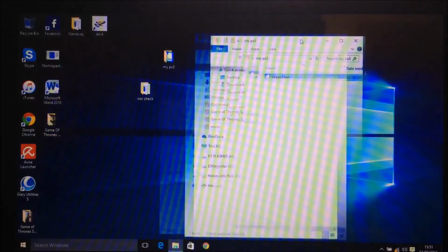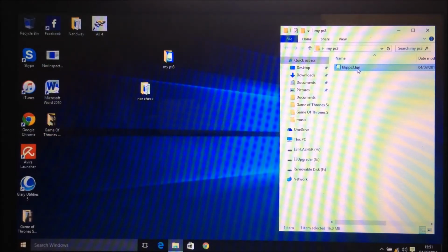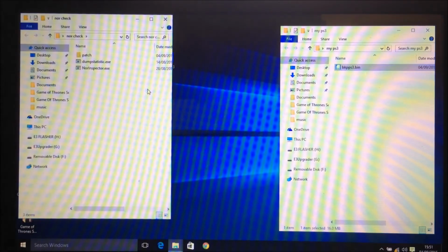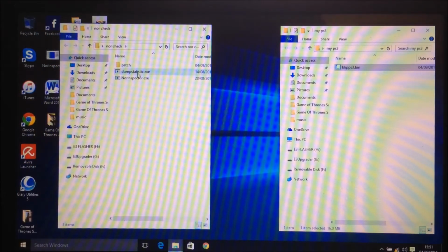Right, so we've got this folder called my PS3, and that's got the dump from the PS3 on. And then we've got the Nor Check folder. As I said, I'll put a link for this in the description. Inside the Nor Check folder will be Nor Inspector, Dump Statistic, and a folder called Patch. The Patch folder is just Dump Statistic's patch, so Dump Statistic has always got to be in the same folder as Patch, but that's not a problem, just leave everything in here.